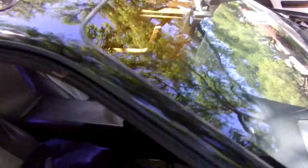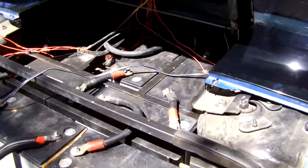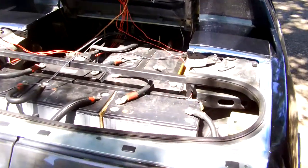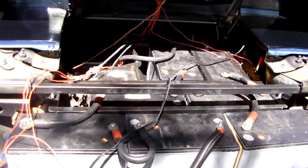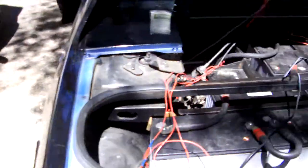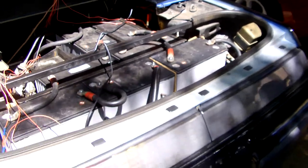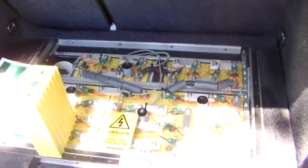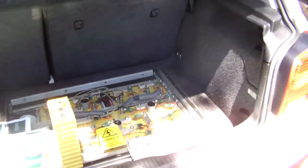This is what we call the old school — I've seen these 10 years ago. These are the golf cart batteries. This car had golf cart batteries in it until those. Those are just AGMs — AGM batteries. What's AGM? Absorbed glass mat. It's still lead acid, but it's a sealed lead acid battery. It doesn't have all the slots. It's not a gel — it's still a liquid. The glass mat has actually absorbed the lead acid into the material. So you can actually puncture the battery and nothing will leak out, but it will evaporate out.